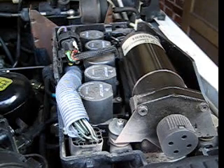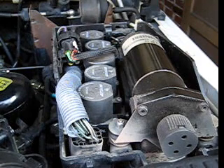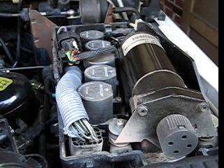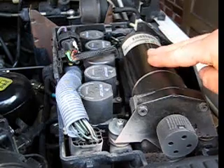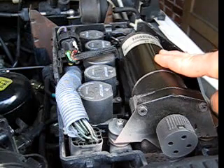In this video we're going to talk about the EAS compressor. A couple of sensors interact with the compressor and the EAS computer to determine when it's appropriate to run the compressor. The EAS computer has a pressure switch and also a temperature sensor that it relies upon to trigger the compressor. If either of those two sensors are faulty, the EAS computer will never actually attempt to trigger or run the compressor — it will just stay completely dormant.